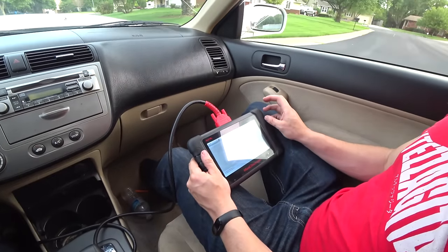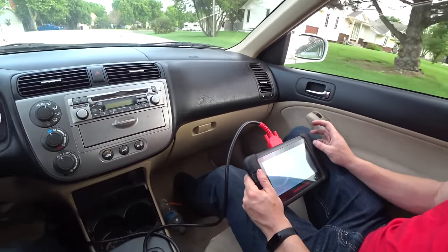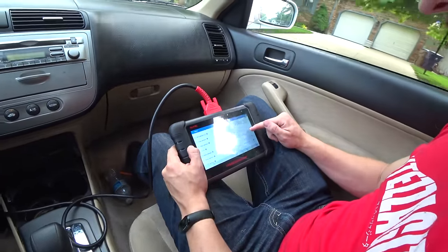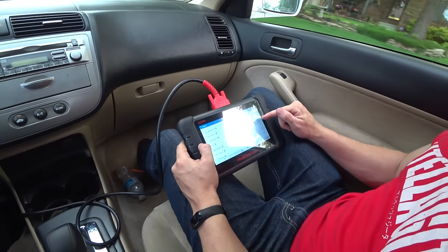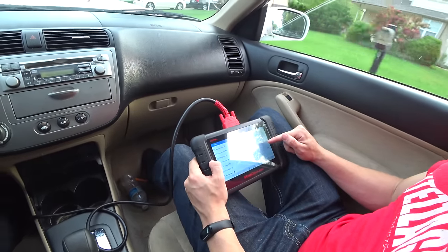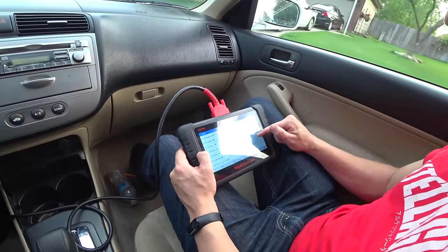I'd like to read live sensor data, but everything takes 8 years to happen here. This is one of those really hard to deal with, middle of the OBD2 era cars. It takes almost 7 minutes to scan all the modules, so it's a long, long wait. So we're just gonna keep going around the neighborhood here at 10 miles an hour and taking a look at data. O2 sensor feedback, this, I hope? This does have MAP sensors. And those are outputting data: barometric, throttle position, seems to be doing stuff.